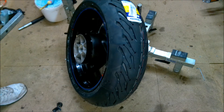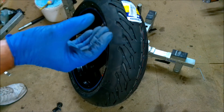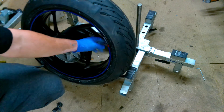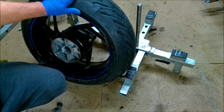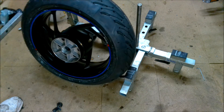There you go, all done, ready to go on the bike. I hope that helps someone. It's been a few tire changes for me to find out especially about clamping the tire together and pushing it into that inner edge where your spokes meet the wheel. Your wheel shape is like a valley so it comes down into that middle valley and gives you a bit of extra room to get it on. As you saw - one-handed, no problem at all. Plenty of soap, goes straight on. Please feel free to leave any comments on how to do it easier or better - any advice greatly received, and thanks for watching, subscribe for more.